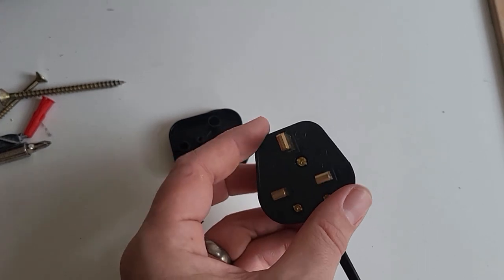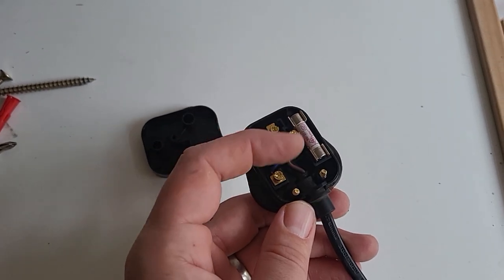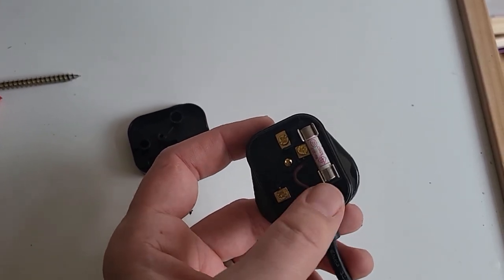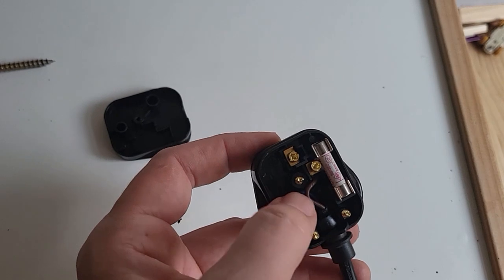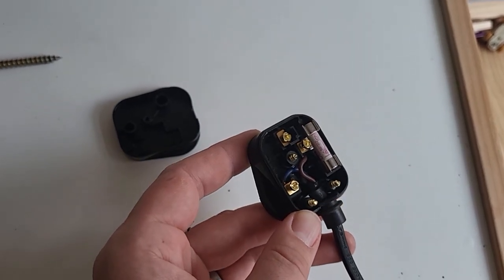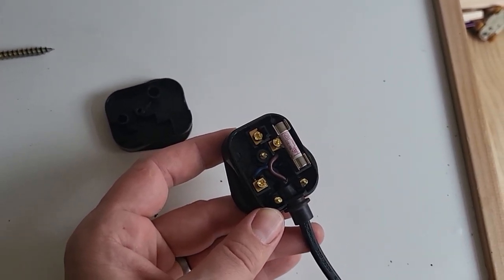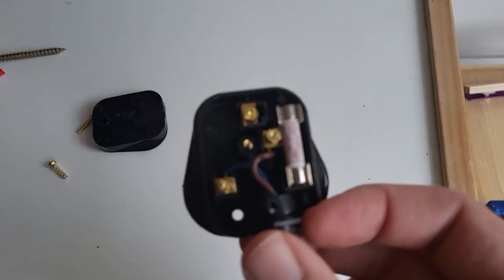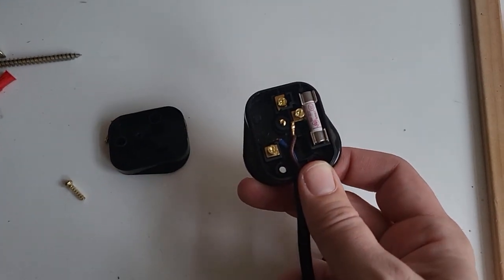The back is off. Now all you're doing is taking - you might have an earth wire - but you're taking these off and these out, so you're taking the wire completely away from the plug. First things first, take these two out here, and then these two, and potentially an earth wire if you've got one. Remember the configuration of these wires - it should be blue, brown, and then a green/yellow. Be mindful that there might be different colours depending on the age of the plug. So I've loosened everything up in this plug and now I can just pull that lead out.